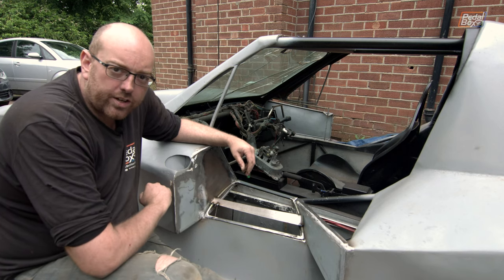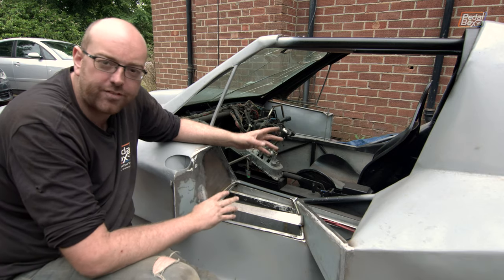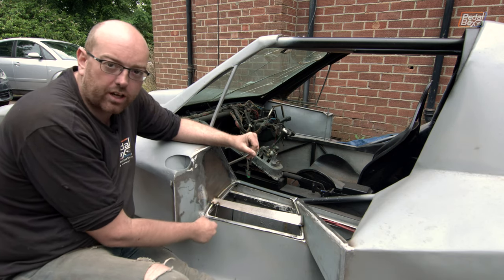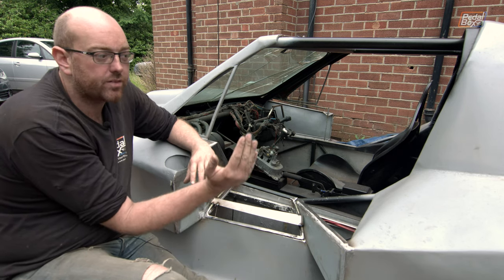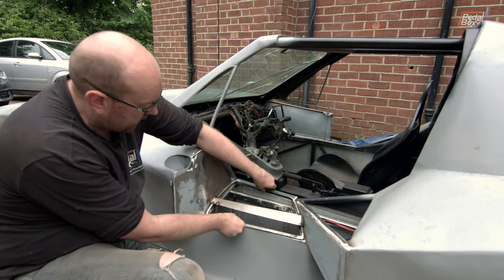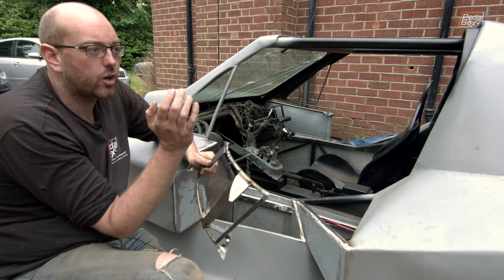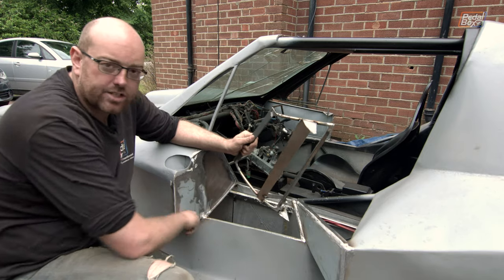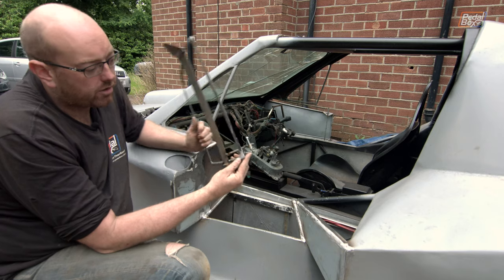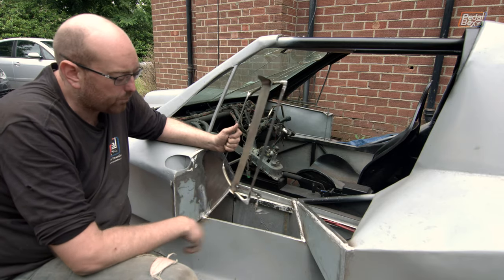The second version of that works a lot better than the first. The first had the pivot in the wrong place so it was immediately clashing into the bodywork - I forgot some fairly key points of hinge theory. I needed the pivot point much further below the piece I was trying to avoid, so that when it started pivoting it came up and moved around in a much bigger arc than the bodywork I didn't want it to clash with. Now it works really nicely. What worked right from the start was the actual pivot point bracket being non-perpendicular off-axis - that worked really, really well and put the pivot dead in line along there.